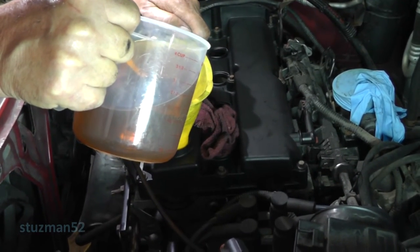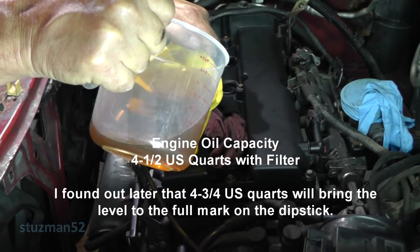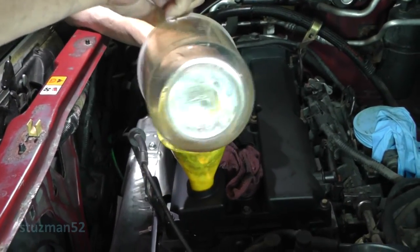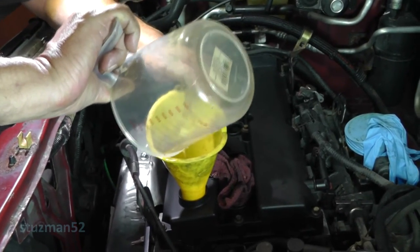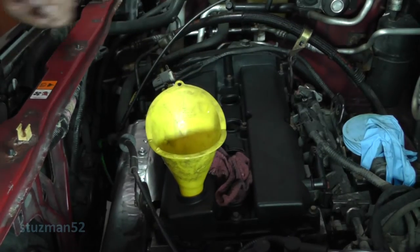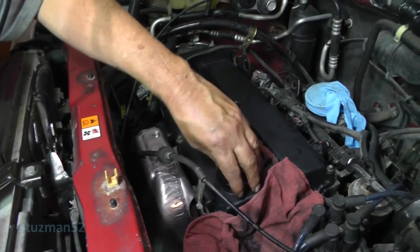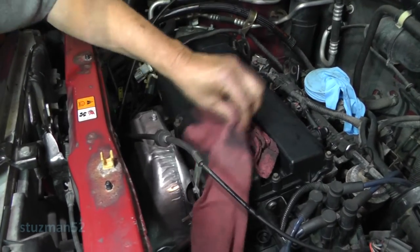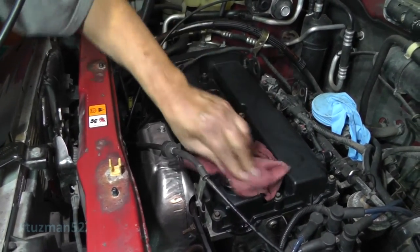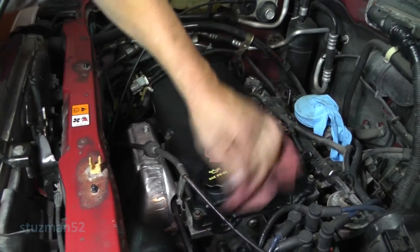I took the oil pan off, so I'm going to be putting the oil in now. This will take four and a half quarts - that's US quarts with the filter. This is 5W-20; you can use your favorite oil. In my case I'm using fully synthetic. Go ahead and lube up your O-ring with some clean engine oil. I'm just wiping away any little dribbles.